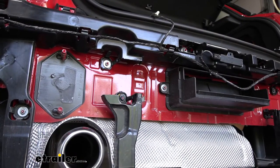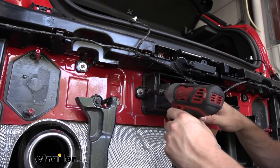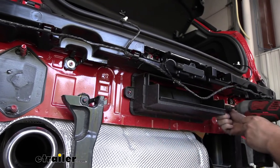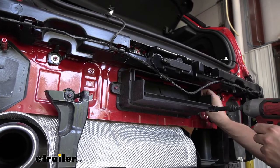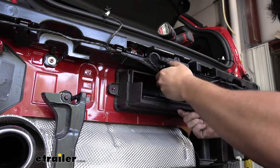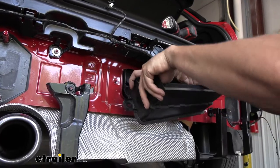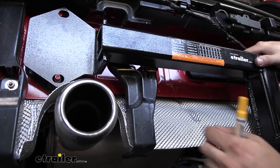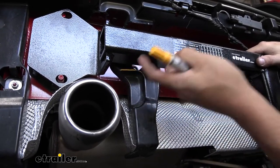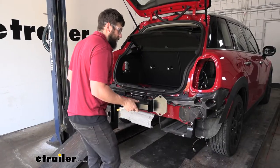Here's how much we have trimmed. Next we're going to be removing the little vent bracket — there's a nut on either side requiring a 10 millimeter socket, and then we should just be able to pull it straight off. We then put the hitch up into position and found we were still hitting on the little plastic brackets, so we marked with the hitch in position to see how much further we need to trim, then test-fit the hitch again.